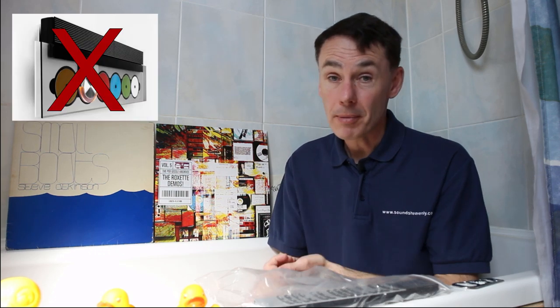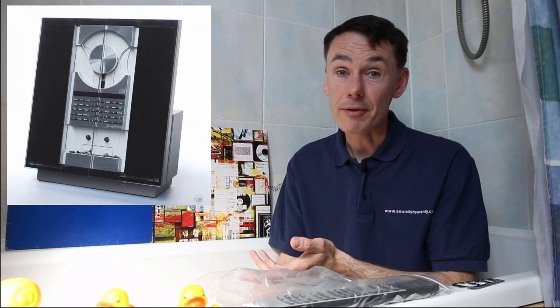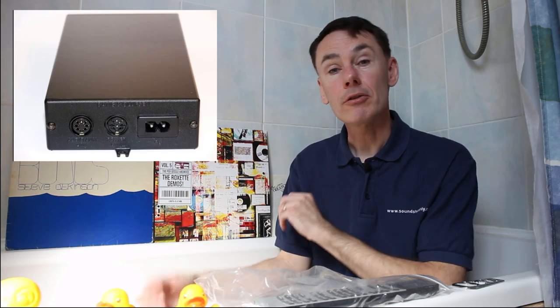I must stress that the later systems — B&O 9000, B&O Master 5, B&O 3000 and 3200 — can't control the record player; they don't physically have the capability. So if you've got Master Link cabling in the house already and you want to remotely control the turntable, get an Overture or B&O 4000. You can also use the earlier 2300 and 2500 B&O centres, but you need a little B&O Link converter box — which looks like a metal shoe box — and that will convert it to work with your Master Link network.